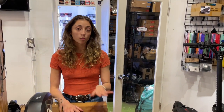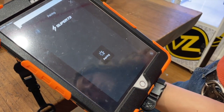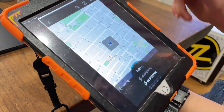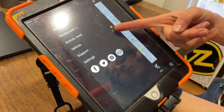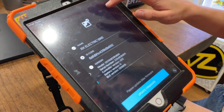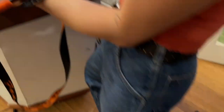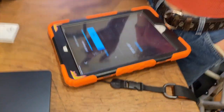The last thing you're going to want to do is make sure your firmware is fully upgraded — you're going to need the Super 73 app to do this. Once you open the app it'll look like this; you can tap to pair your vehicle — it's going to be the only one that pops up as long as your bike is the only one on within range. Go to the top left corner and the exclamation mark means your vehicle needs a firmware upgrade. Tap that exclamation mark and update firmware.